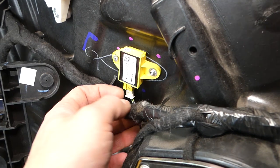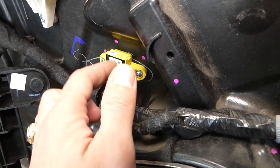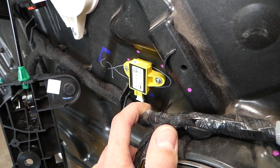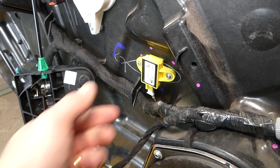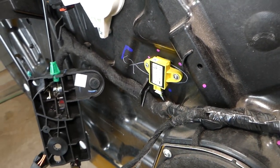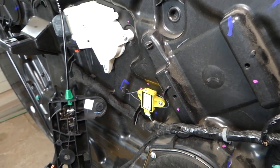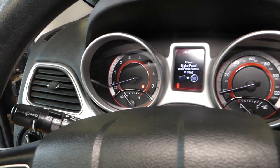Sometimes it will just be a loose connection here — not plugged all the way in. It could be nothing, or it could be a bad sensor. It's hard to diagnose without the correct equipment, though we'll have a video showing how to diagnose them with equipment. We went ahead and plugged ours in — the connection was loose because we had put in a window regulator and didn't snap the connector all the way. It was in, but not fully seated. Now if I go ahead and start the Dodge...